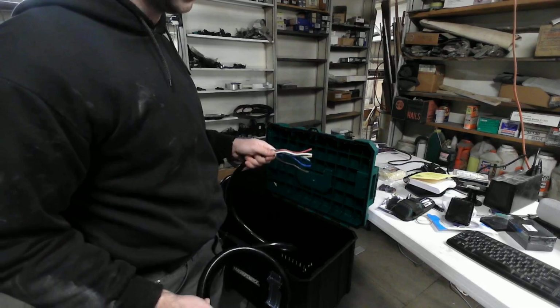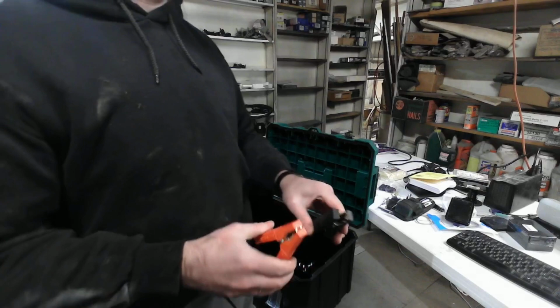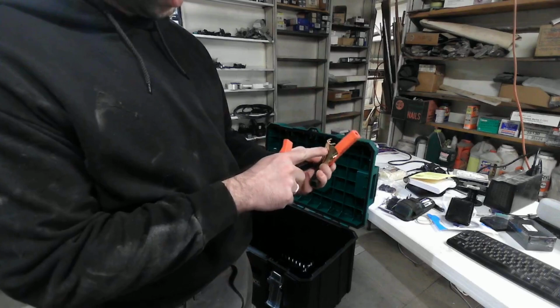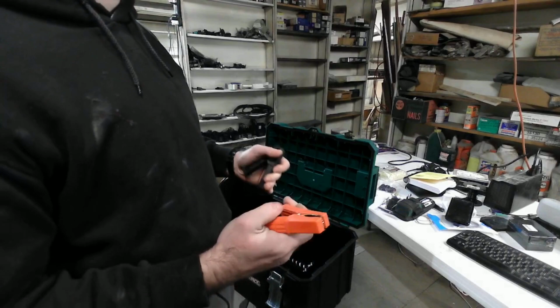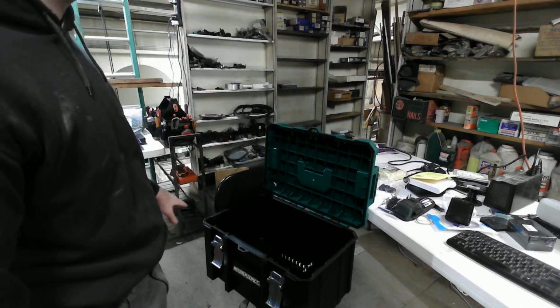And this cable is going to have alligator clips on it. And there are the alligator clips. So you can see they're big battery clamps. They've got the removable insulation. It comes with a bolt, so you crimp that around the cables. You're going to have to use a 6-gauge or an 8-gauge connector to get all those wires together. But anyways, this is the goal, to get them onto here so you can put that on a battery and then plug that into the box. And that'll give you power on all 6 circuits and then ground, obviously.